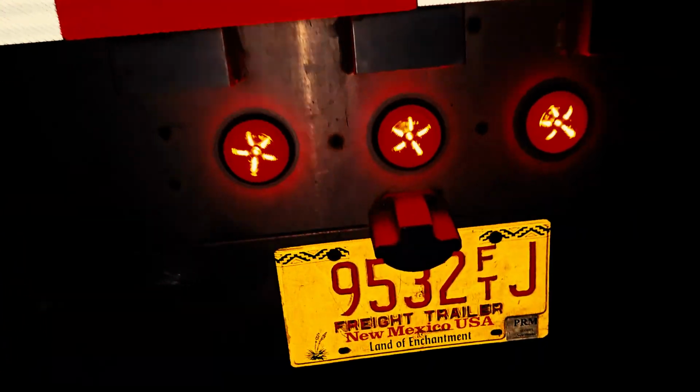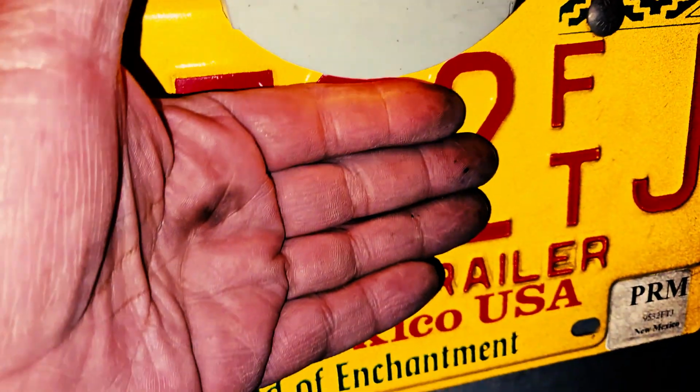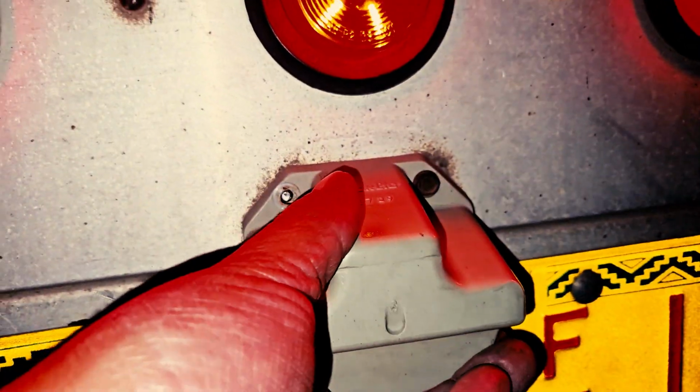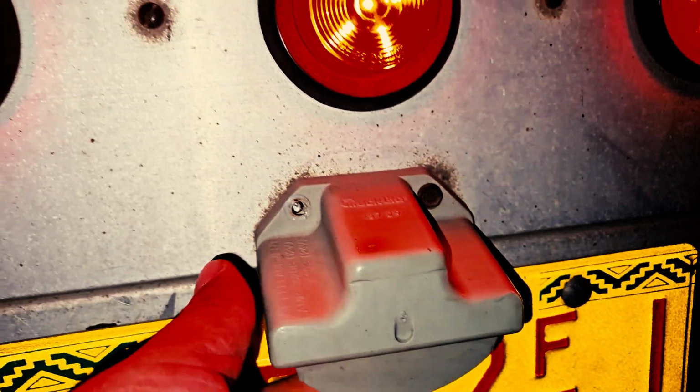You'll come to the rear of your trailer. You would also inspect your DOT ICC bumper to ensure it's properly mounted and secured, and the DOT C2 reflective tape is properly mounted and secure, covers 100% of the width of your trailer's bumper, and also the width of your trailer itself. You would inspect your license plate light to ensure it's properly mounted and secure, that it functions properly, it's on, and it's neither cracked, damaged, nor loose. It's the proper color, clear.